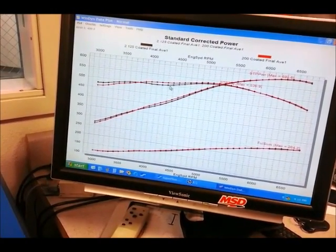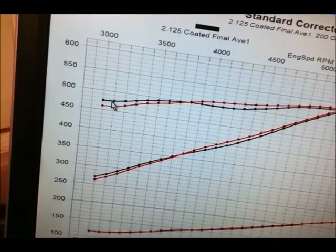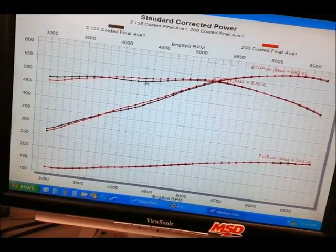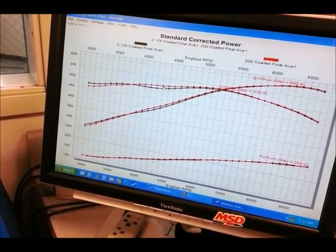So basically these two are swapping at a little different RPM range, which is a clear indication of cylinder filling. When the torque's higher, the cylinder is filled more efficiently, the volumetric efficiency is higher, and because of the way that it's tuning, it's kind of dropped down here a little bit. And the smaller header is actually a touch better.